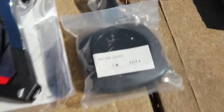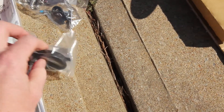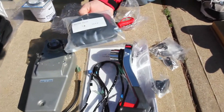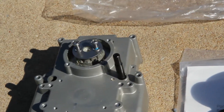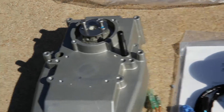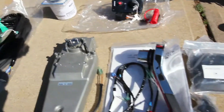And so that's the basic. We just got some other pieces — this goes around, that fits in there. And one trick we'll be able to show you later in the video is this piece here that will cover this tensioner, which needs to be left open for continual tensioning every now and then. So we'll have to drill a hole in this bezel. Suzuki thinks you don't need to do that over time — they're very confident in their gear, but actually you do.